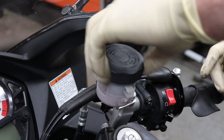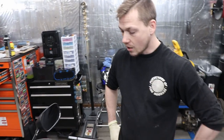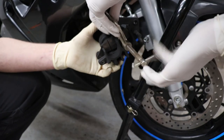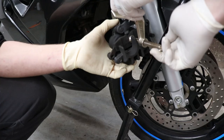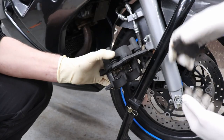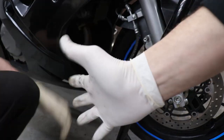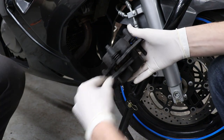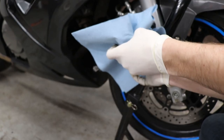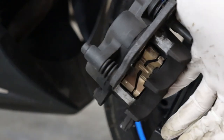Just a very similar reservoir — it doesn't screw, it just holds it down. We're gonna empty that, we're gonna bleed it all out of there. We might as well bleed both brakes too. I think I have a hand pump which we can use, or you just do it by hand. Let's squish a piston — let's squish a set of pistons. So now we just clean it up. I just like to get the dust out of there. I love cleaning.